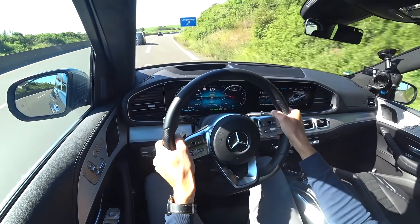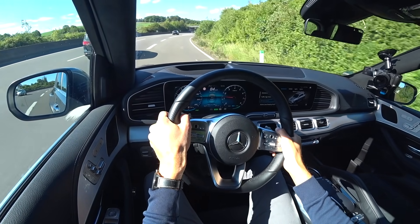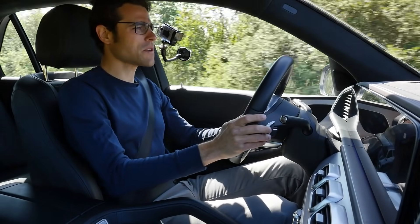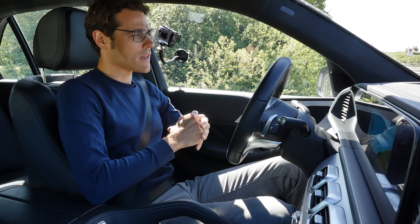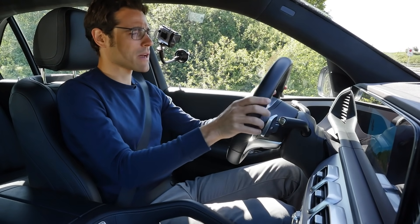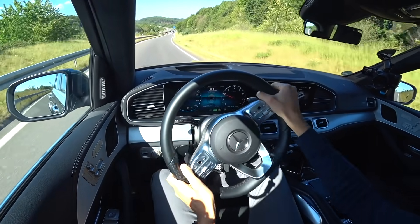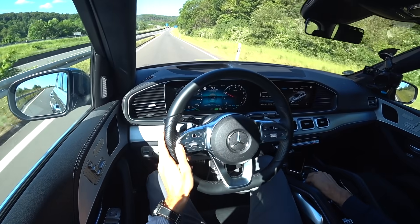In the curve mode, when you go around a corner the car stays upright — this is Mercedes' way of using this diving-into-the-corner approach instead of anti-roll control. It's a very unique driving experience. Heading back to the motorway for a left-right slalom, you can see the car really keeps upright and doesn't lean left and right — the curve system is evening out the G-forces. Really amazing.